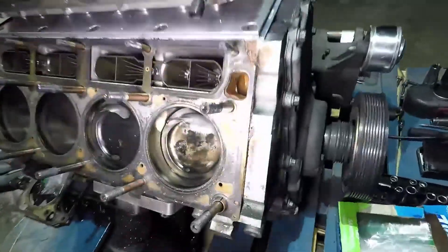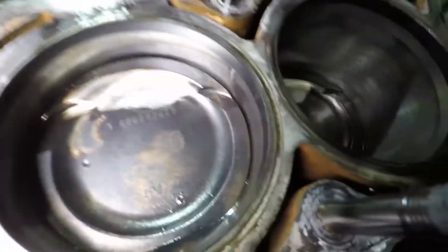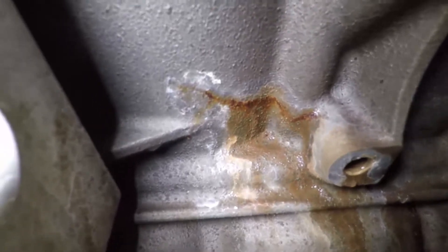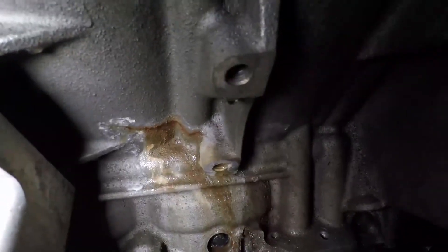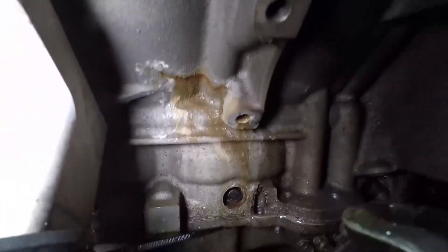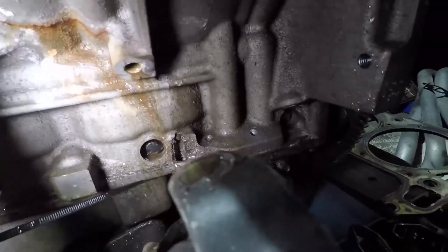The motor is pretty healthy — it's really clean and I could probably still drive on this for years. But the problem I do have is this hairline crack right here on the block, and water is actually leaking out. I'm thinking the problem is with the Daft Innovation mount because it only uses four of the six mounting holes, so there's a lot of stress on the back right here twisting the motor. Next time I would probably use a motor plate that uses all six holes to give the motor more structural integrity, and that probably wouldn't have happened.